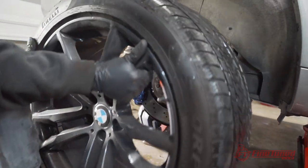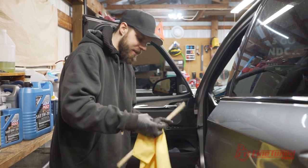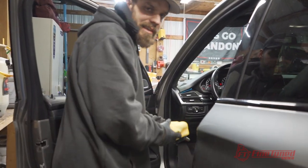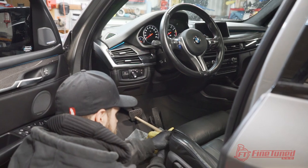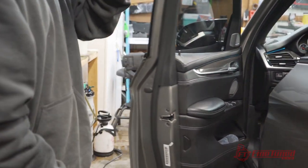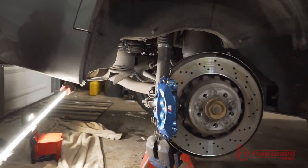Let's pull this off, pull the brake lines off and go from there. What I have here is my special BMW tool — a wood stick. Basically the whole purpose of this is to apply the brake pedal down, so that way when I open up the lines, no air goes back through the lines, which just makes it easier for bleeding later. So apply the brake and put that right on the seat.